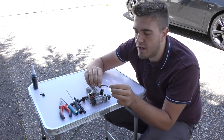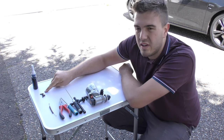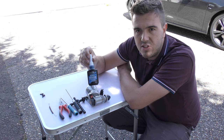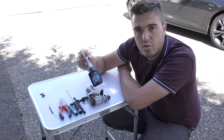I tend to like to replace them as after a long time they do stretch out and lose their springiness. So I'd recommend using a new spring when popping a new engine in. I've got all my screws and also definitely some thread lock — we're doing metal to metal screws on the engine with lots of vibration, so you're definitely going to want to use some thread lock to stop them coming loose.